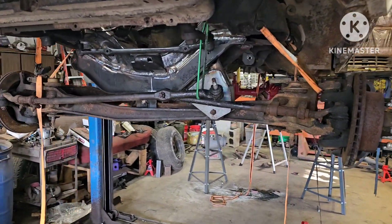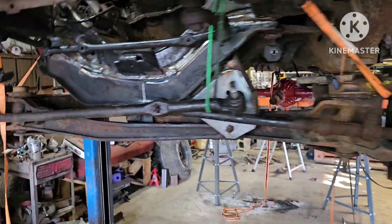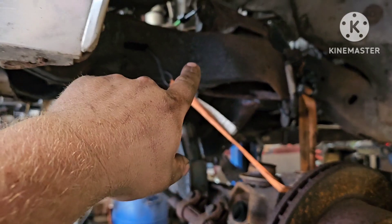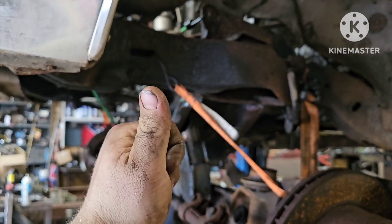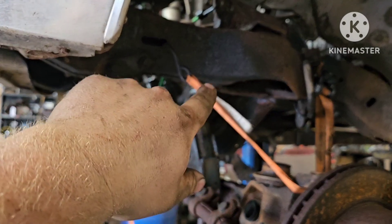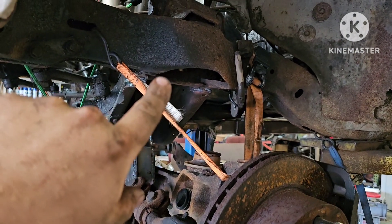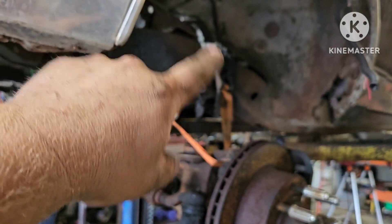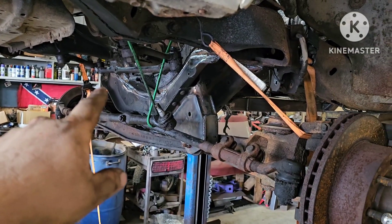With a little bit of movie magic, I got my drop brackets done — they turned out pretty alright. Now I've got to trim the old spring buckets out, and I think I'm going to cut the spring buckets off of the van frame pieces and just retrofit them back in there to save time. After that: spring buckets, shocks, radius arm mounts, steering — you get the gist.